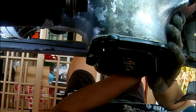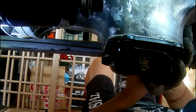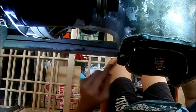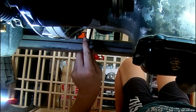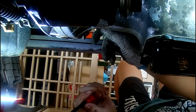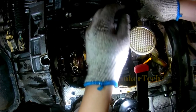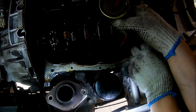After removing the last two bolts, the upper oil pan can be removed by prying slowly on the side. Make sure to be careful prying, as it is made of aluminium that can be easily scratched. As usual, always clean whatever parts possible, which is why my DIY work always takes so long.